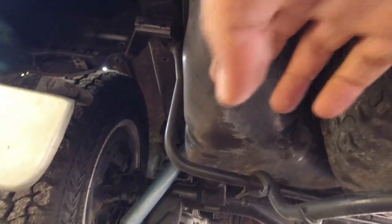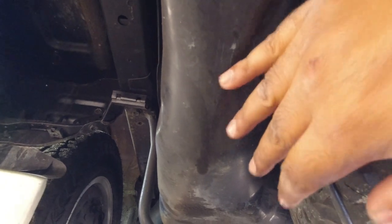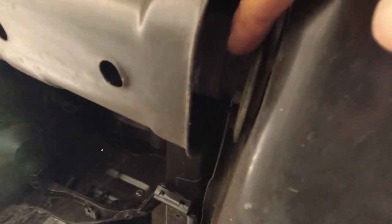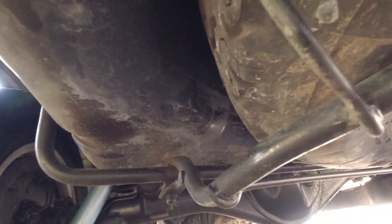And this is your fuel tank here above the spare tire, and it's made of steel. You want to make sure that there's no dents, because if the vehicles are used severely off-road, sometimes they can drop down onto a rock or something, push this in, and all of a sudden you lose like 4 to 10 liters of fuel capacity. Again, have a really good poke around, not just at the underbody, but you're looking at all the little things at the top as well, making sure that there's no wet spots, which will indicate a leak in the fuel tank.